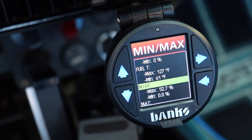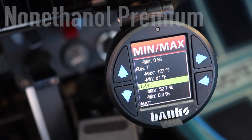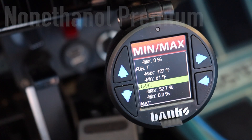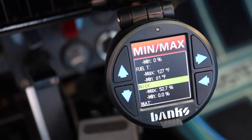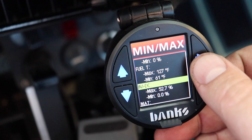Fuel temperature — that's getting pretty high. I added a flex fuel sensor, so I could run E85 on this turbo Slant 6, but it's not really available around here so I haven't gone that far. I use it to know if it's premium or regular fuel. With that, it also gave me a fuel temperature on the return line. Definitely a heat soak in the fuel rail there, as you can see.